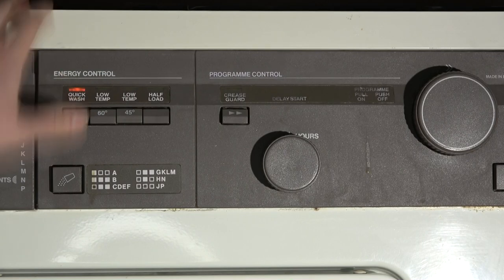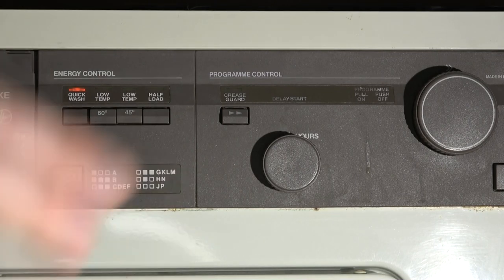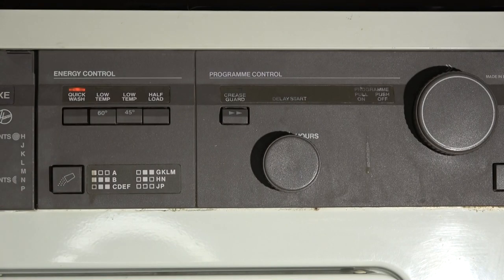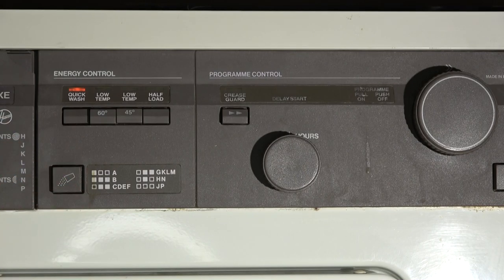Right, so quick wash option. This can only be used in conjunction with program L, minimum iron, to give roughly a half an hour cycle. In fact, when I actually used it, it took just 28 minutes to wash lightly soiled laundry. It doesn't reach 50, it reaches around 30, 35. Now, it just says it is made for lightly soiled, delicate items. You can still wash up to 2 kg, but it is only supposed to be used with minimum iron program